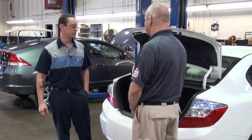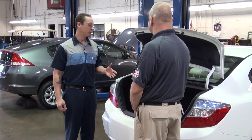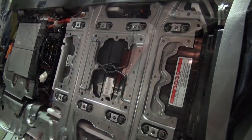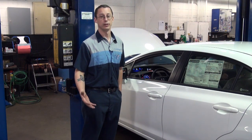Ross, similar to the other vehicles, the shutdown procedures are essentially the same. The new difference with the brand new Civic Hybrid is that it uses a lithium-ion battery pack, and the battery pack is actually located behind the rear seat instead of on the trunk floor. As with all Honda hybrid vehicles, simply turning the ignition switch off will disable the whole vehicle.